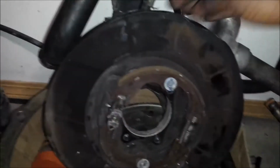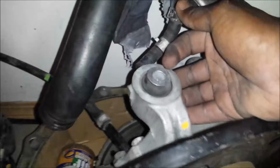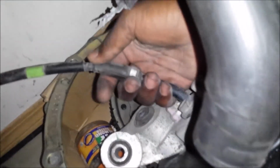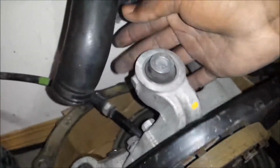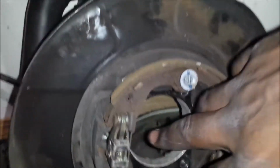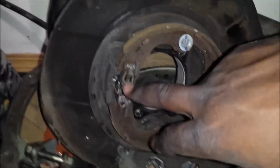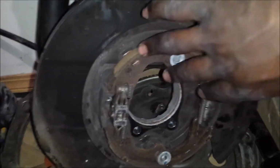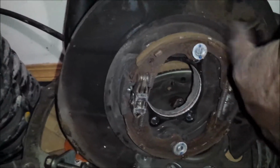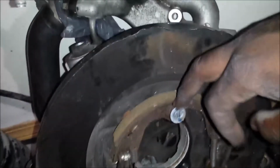I've talked about e-brakes with the three cars, and I just happen to have a part here, so let's look at it. So here you go. This is, as it comes in from the bottom, your brake cable. It is all mechanical actually. So mechanically actuated, and once you pull whatever you need to pull up top by pushing on your foot brake, that pushes out, and then these shoes exert friction on the hat. So nothing hydraulic about the e-brake over here, unlike your normally actuated brake shoes. So yeah, there you go. The shoes look pretty good still.